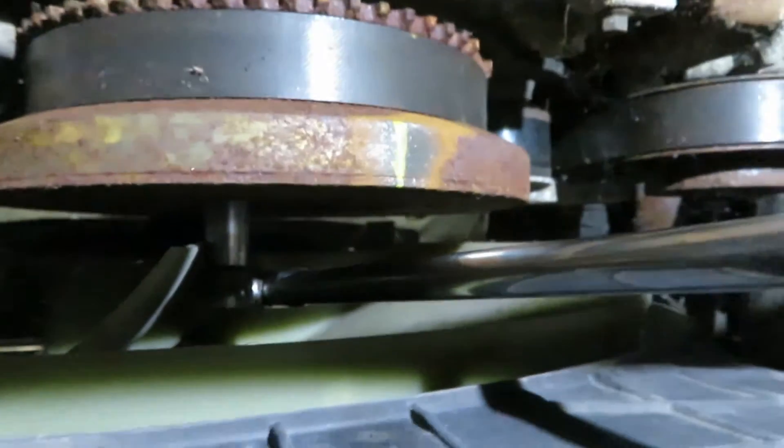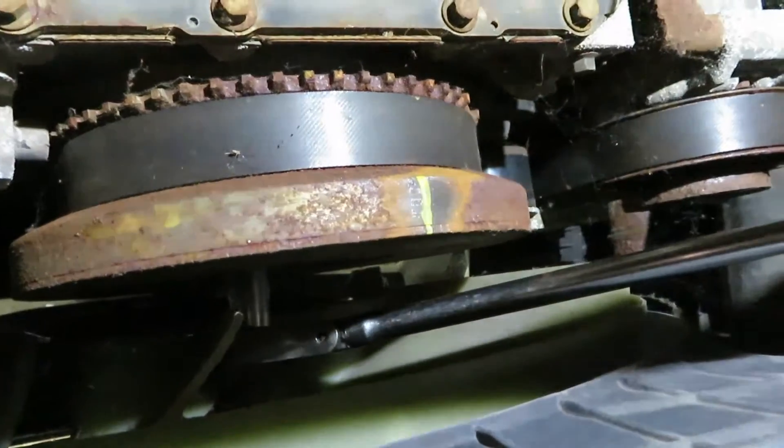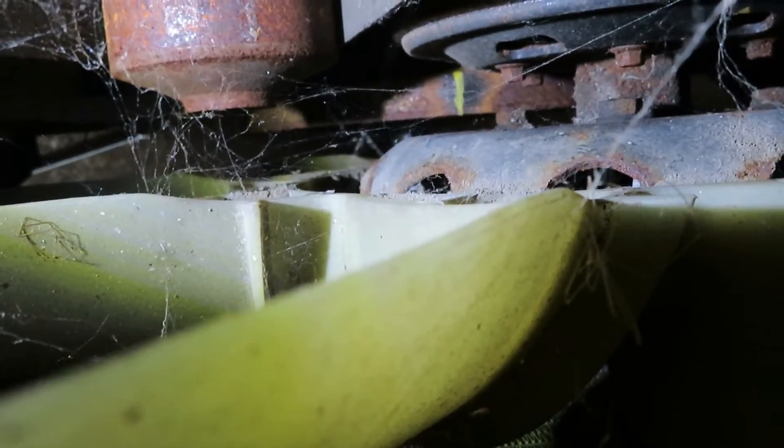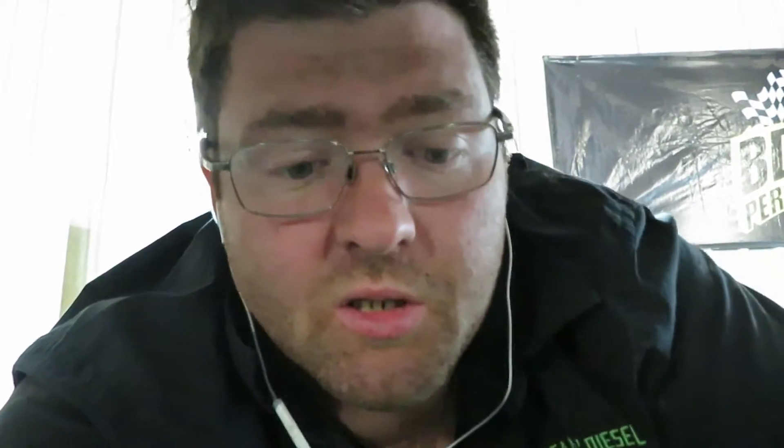Once you get the mark, you have to turn the crank so that mark is at the 12 o'clock position. With it at the 12 o'clock position you can adjust half the valves. If you have it on number 1 — the front cylinder — at top dead center, both the intake valve and the exhaust valve will be loose. In this case these are tight, which is not a problem; it just means you adjust the other half of the valves. So in my case right now, cylinder 6 will be at top dead center.